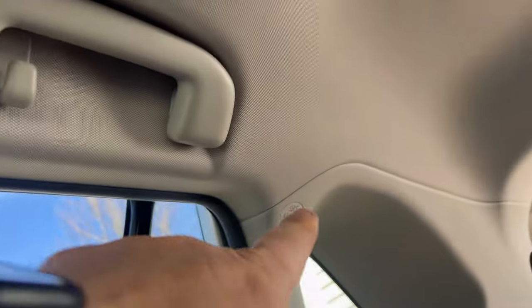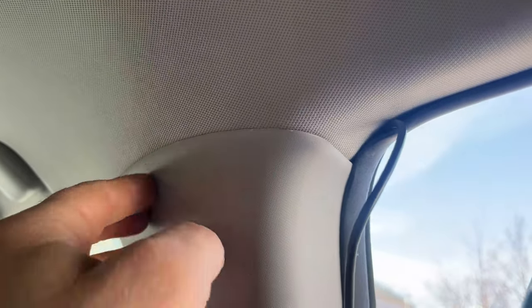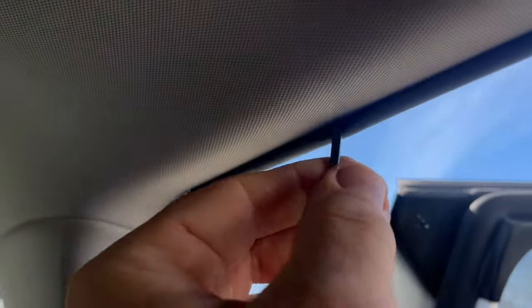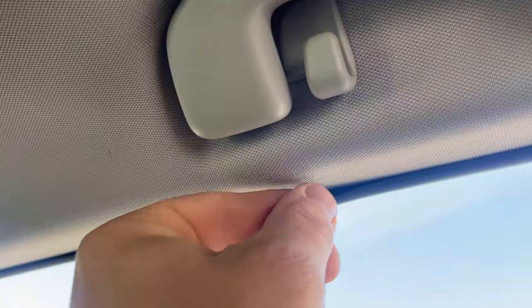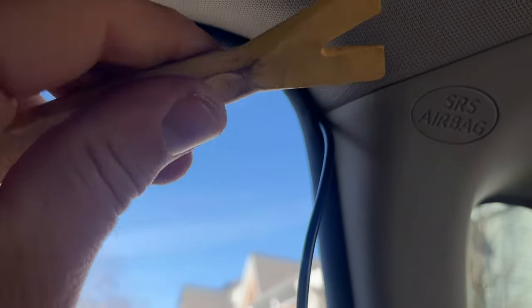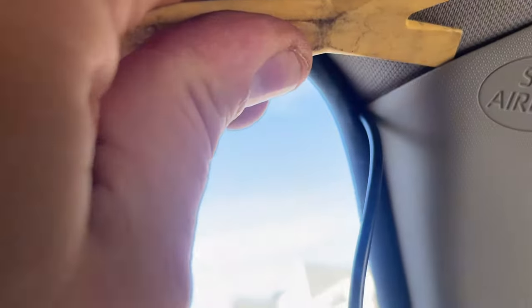Guide the remaining cable all the way to the back panel and all the way out. See how this cable is hidden nicely — it goes along here. Push the remaining through under this rubber piece all the way until we hit this corner. Once at this corner, use your plastic trim removal tool again to pry it a little bit so you have space for the cable.